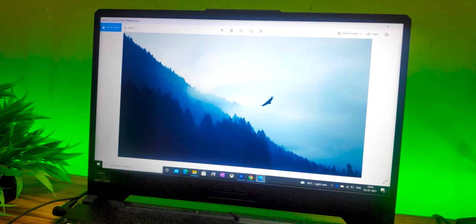But on the other hand, when it comes to an LCD display which is backlit, now in order to produce these black colors, what they indeed do is they have this diffuser that just blocks the light from reaching your eyes. So it does not consume less power when it is dark mode like the AMOLED display did. Instead, it just wastes some energy.